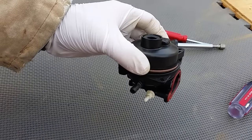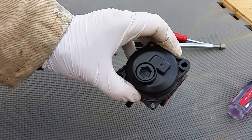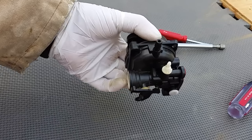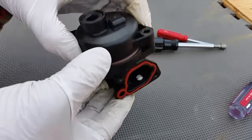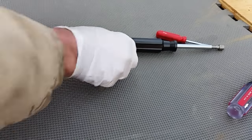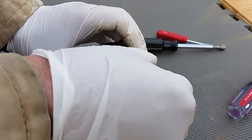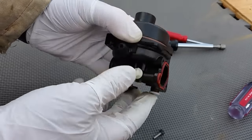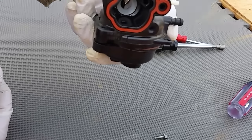This is a plastic carburetor on a Briggs & Stratton 5 horsepower motor — you're going to see them a lot. Here's what you do: take these things apart. You can get to this point and there are some 7 millimeter bolts holding down the bottom, and that is the bottom of the carburetor where the gas develops and the float works.